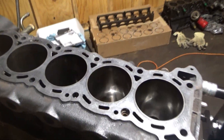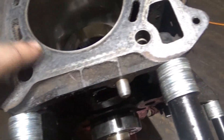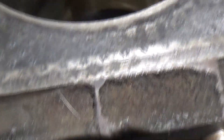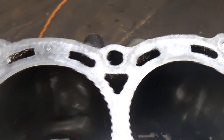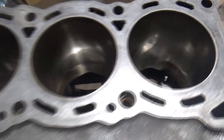I just talked to my machine shop guy — I think I'm just going to get the block decked just to be safe, because I couldn't get... you can just barely feel those little marks from the old composite head gasket. I got it pretty smooth with a plastic razor blade, but if I'm going to send the block and pistons to get the clearance checked, then I might as well get it decked, right?